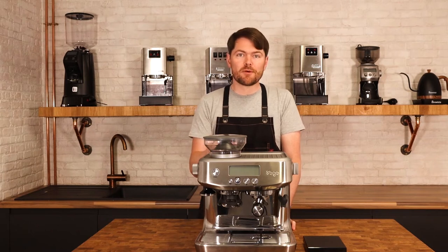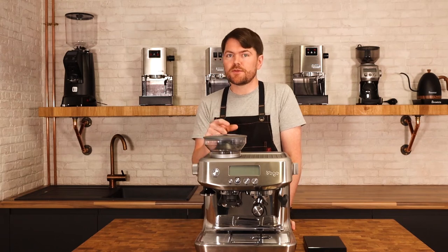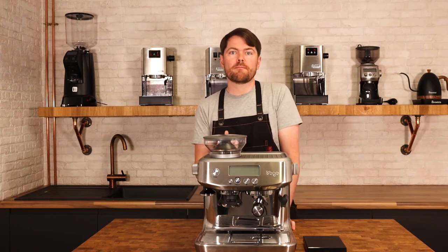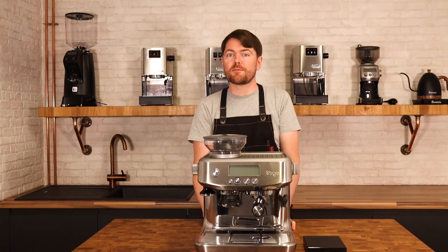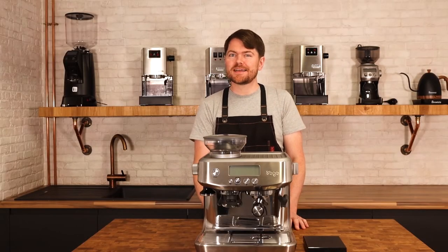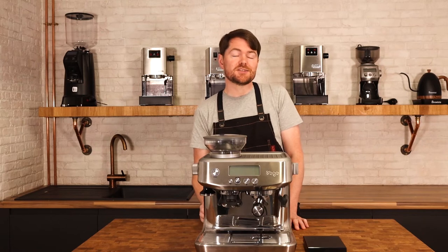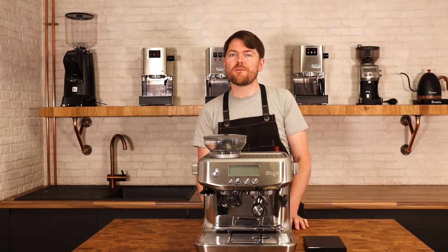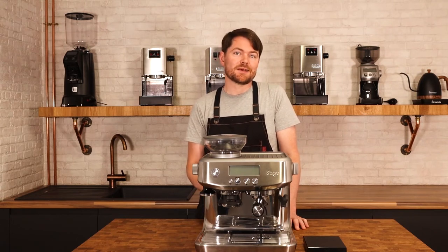All you do is take out the top burr — move the hopper first obviously, remove the wire — move the top ring down one step so instead of the red dot being above six it's now above five, put it back in, put the hopper back on, purge another basket of coffee and pull another shot. You should find that going one notch finer does the trick. If not, try again and drop it another notch finer — but to be safe, if not much seems to have happened, just try one more shot without changing anything in case you're still seeing some retention. Don't go overboard taking it down loads because you'll end up with the burrs clashing together, which isn't good.